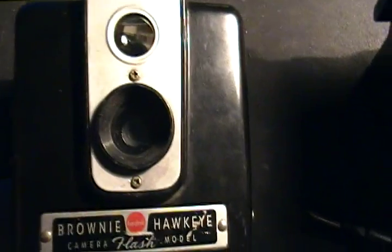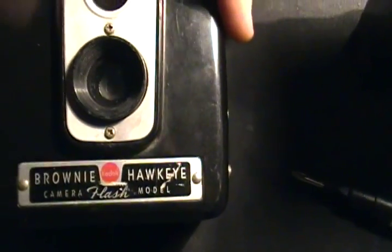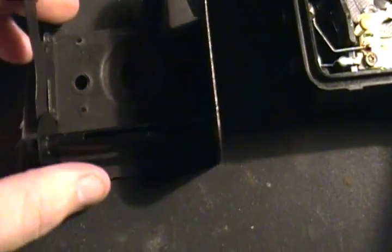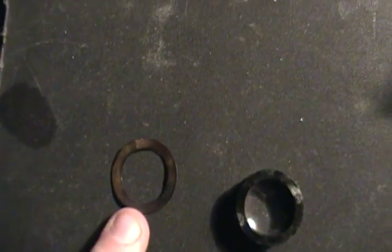Let's say the back of the lens element behind the actual shutter — let's say that the inside is kind of jacked up. Inside there are two screws. You just undo those screws and then this back is going to come off. Inside there is this washer, which mine is extremely beat up. I'm going to end up sticking it back in there, but I need to get a new one — I just need to find a replacement.